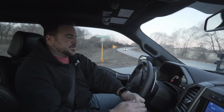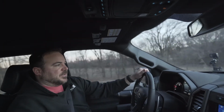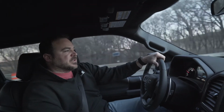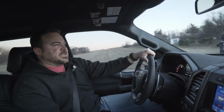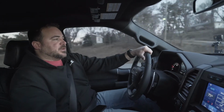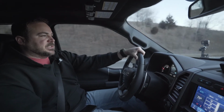We have some dyno graphs that show that, but it's not really beneficial to run torque that high on these motors. One, the transmission can't deal with that down the road, that big of a torque hit, and two, it's just not sustainable. If the user were to find kind of a bad tank of fuel, the engine would run into a lot of knock and then extract a ton of power out of the ECM. So those are the findings that we had, and actually some of the challenges with the ECM.